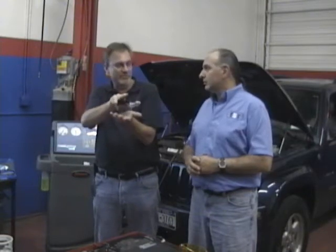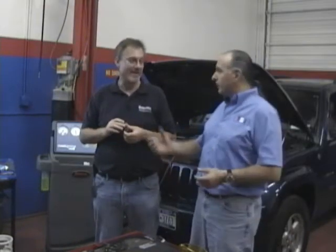Speaking of that, there are a lot of cheap parts out there. If you have a particular vehicle - a R12 or R134A system - and you put a different condenser on from Joe Schmoland that's cheaper, it's not going to be a bargain because it may not have the same capacity as the OE or a good name-brand part. Be careful, there's a lot of that junk out there. It may not meet the SAE requirements, especially when we look at new SAE standard 2911, which says if you're going to make something to SAE spec for R1234YF, you have to register that product with test results from a registered laboratory.